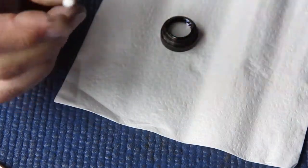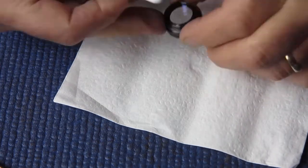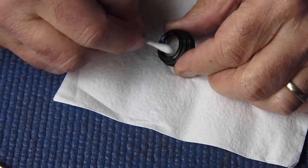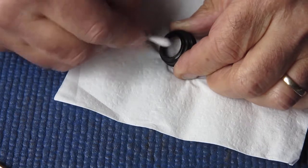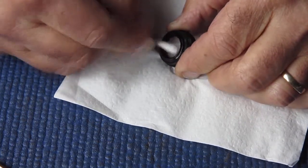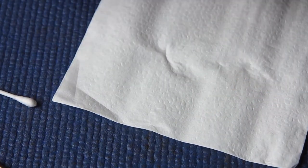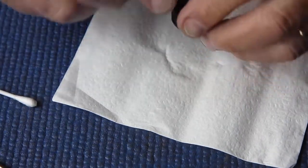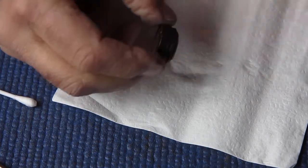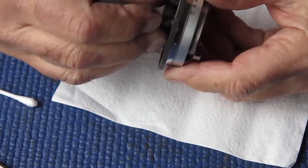If you attempt to do the opposite and take a lens set from a rangefinder camera and fit them to a reflex, you'll find that the mirror will hit the back of the lens, which is a bother and a nuisance. Of course, you only find that when the focus has been racked back to the normal rest position at infinity. If you're testing it racked further out, you wouldn't notice any problem.